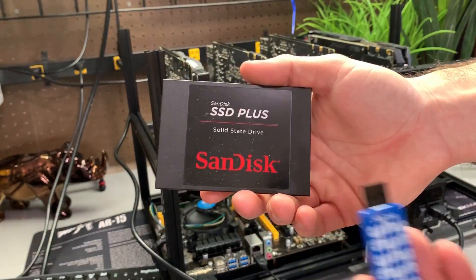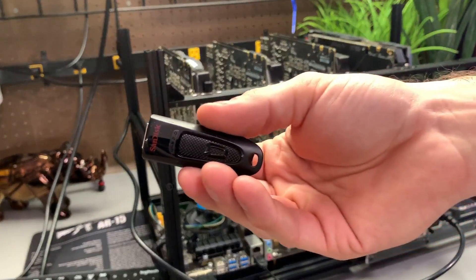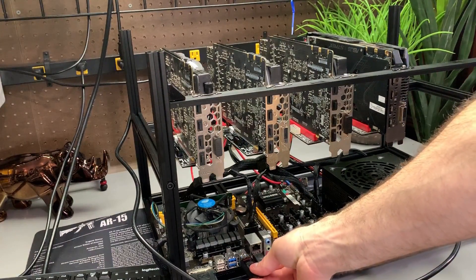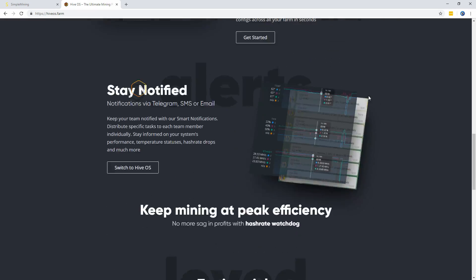If you're going to be running your rig on Windows, go ahead and install a copy of Windows using an install USB and connect an SSD or a hard drive to run it. If you're going to run your rig off Linux, simply insert the USB into the rear slot. If this is a dedicated mining rig, I recommend using a Linux-based distribution for a mining OS, something like SimpleMiningOS or Hive. There are many others out there, and you'll want to research a little bit before you choose one.